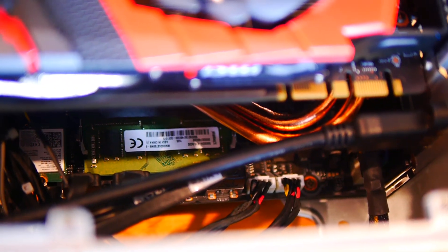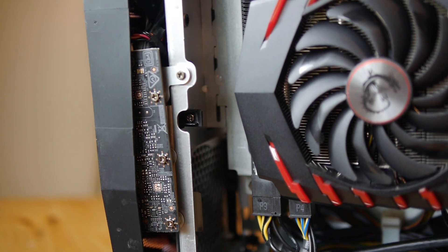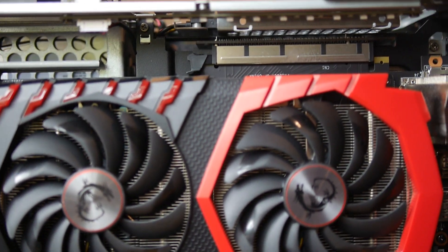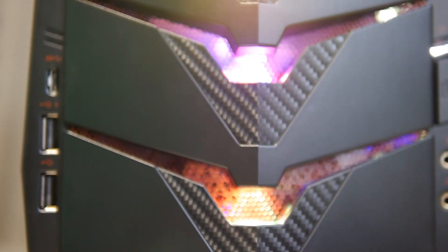The GPU itself doesn't kick in its fan until 60 degrees, and under stress it got to around 78 degrees — but that's fine. The GPU being separate could allow for some extra airflow away from the motherboard itself and pushes air out through the mesh on the side of the case. The good thing about the cooling is it works and it's also very quiet — I tried to record the outside of the case, and either way it wasn't much different to my main rig, which actually has soundproofing panels inside it.